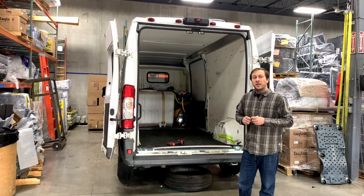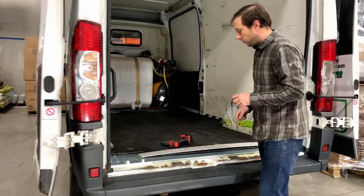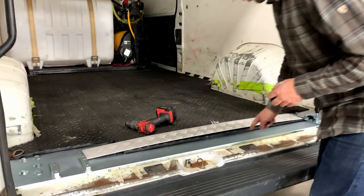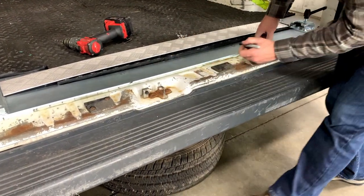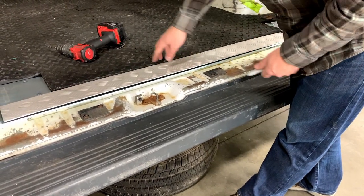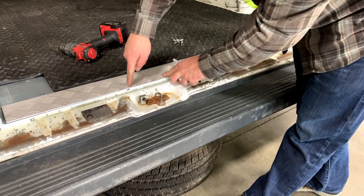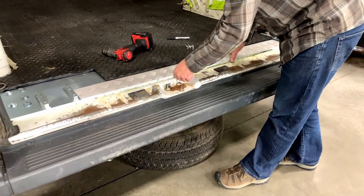Here's a helpful tip to avoid frustration when drilling for the rivets: where we had placed the two lock bolt holes, mark the end of the plate right there about where that bolt is. When you place the trim plate, you don't want to accidentally try to drill through and place your rivet there — you want to know roughly where that is so you can drill to either side. Then we'll start our drilling.